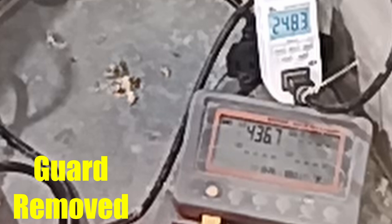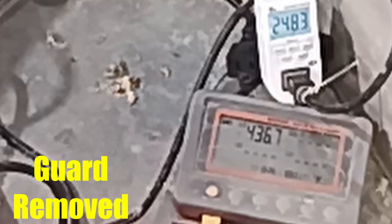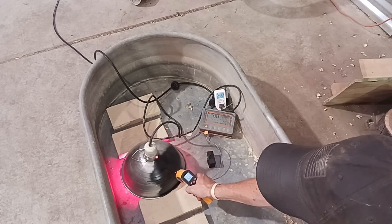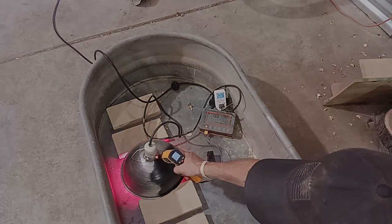Without the guard in place, the max temperature measured is 439 degrees Fahrenheit near the center of the diffuser — and keep in mind there is a slight air gap between the bulb and the thermocouple. It took about 11 minutes to hit that temperature. During this test, the electrical power meter read between 244 and 248 watts, again pretty close to the rated 250. I also checked the surface temperature of the diffuser housing, and the hottest area hits around 200 degrees Fahrenheit according to the infrared thermometer.